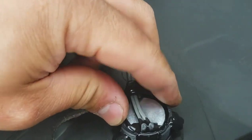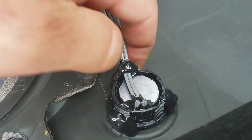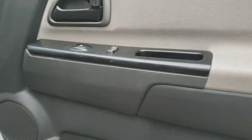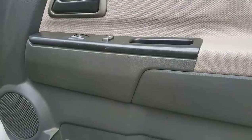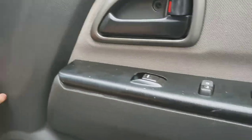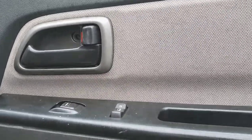But this thing is hard as it gets — the only time it would come off is if you heat that ABS plastic back up. I'd suggest doing the same, or you can use hot glue or whatever holds it in well. For the driver's side front door panel — these ones are pretty easy. There's one Phillips screw here and two Phillips screws here, and the whole door panel pops off. Make sure you lift the channel here — start from corner to corner to lift it up, then push the door panel up so it releases from the channel without breaking. Let's move on to the passenger side.